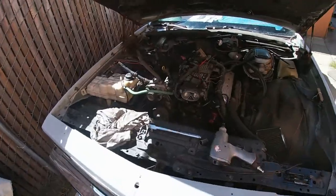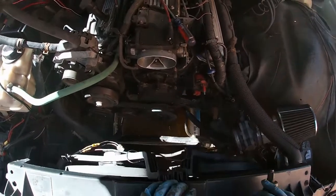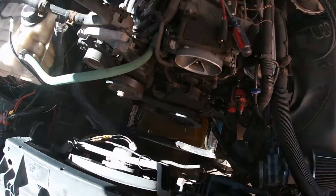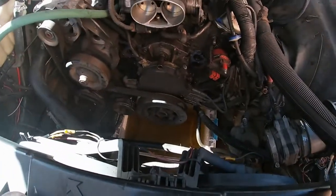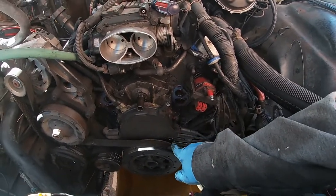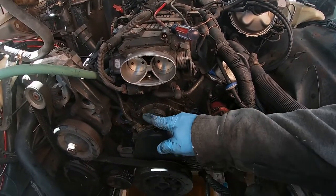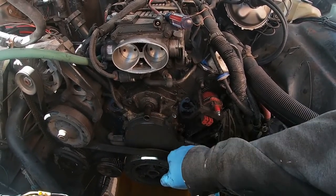Well at least we got the water pump off. Now I can put that there. This is going to spin so fast — there's no choice but to pull it off instantly. So I think that's what I'm going to try to do. There it is — step one done. We got the water pump off. We're down to the OptiSpark — old and nasty, it looks like an original one. I'm going to spray it off first. I feel like it definitely has oil in it — that's the problem, they get oil and they get water in them from the placement of where it's at.